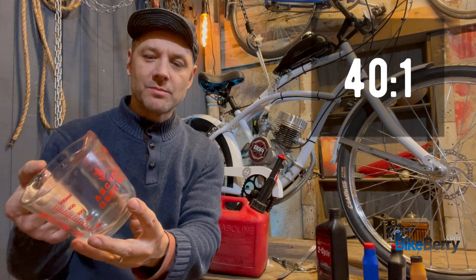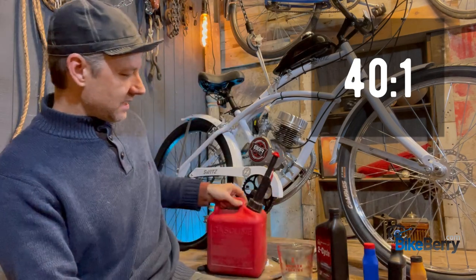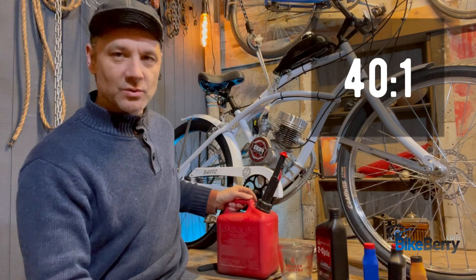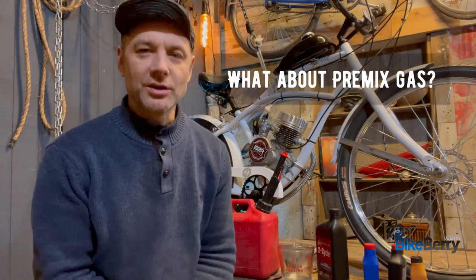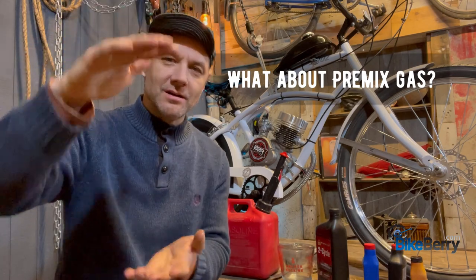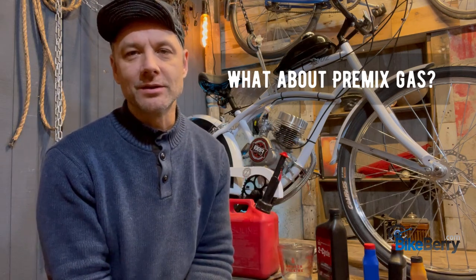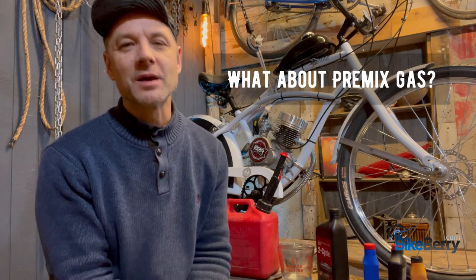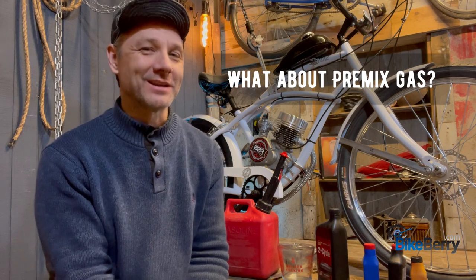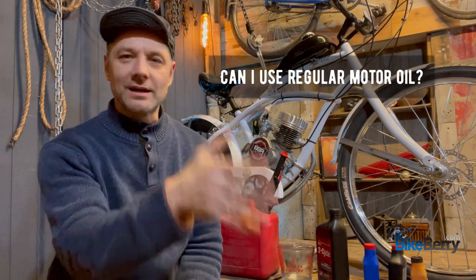To keep it simple: this measuring cup has four ounces at the bottom — I put in just under that, dump it into my gas can, go to the gas station, fill it up, and everything mixes. It's run fine since day one. You might also see pre-mixed fuel at the hardware store — one-gallon metal cans at 40:1 or 50:1, ethanol-free. You'll get excited about that, but think about it: that's twenty dollars for one gallon you'll burn up quickly. Just use what you have — it's totally okay.